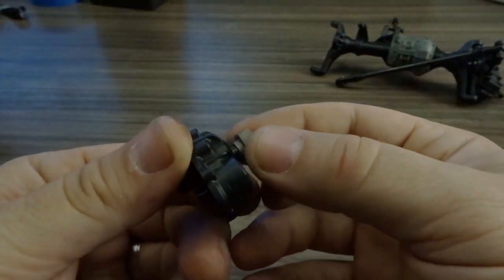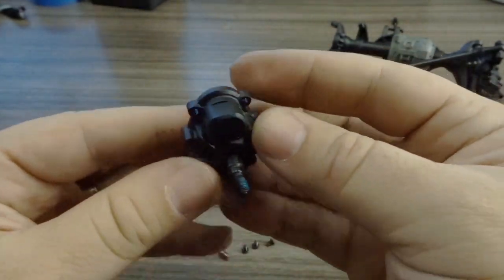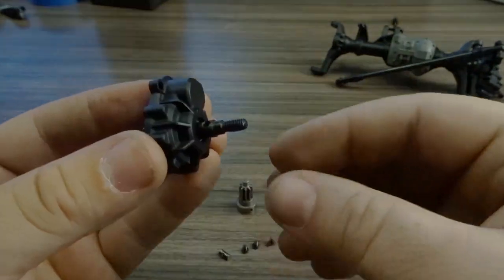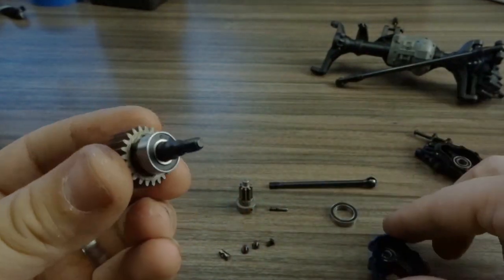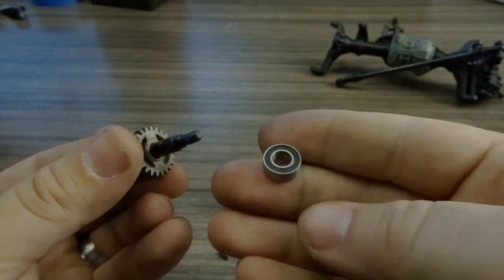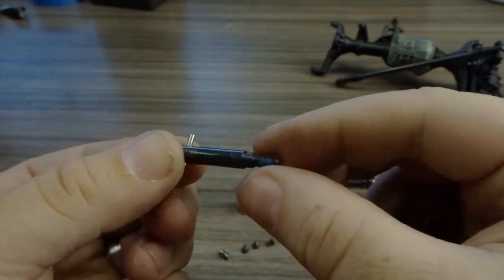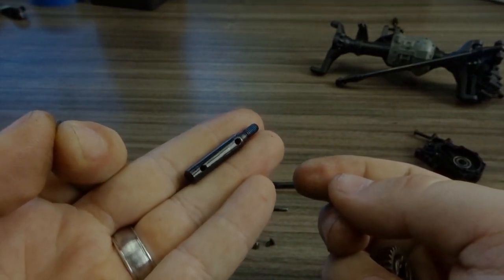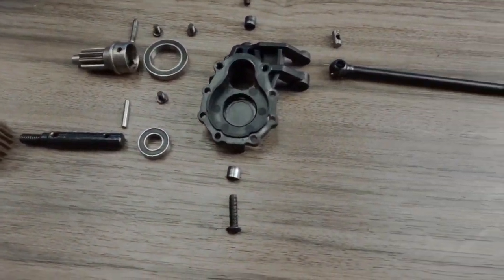The set pin retains the 12 millimeter hex. This 12 millimeter hex rides on a six millimeter stub that necks down with four millimeter standard wheel threads. This gives it a very nice beefy design because that two millimeter pin rides on a six millimeter shaft rather than a five millimeter shaft, giving you a lot of extra strength. You can remove that last outside bearing and you can see that the bottom portal gear is attached to that sub axle via a standard two millimeter pin. At that point it gives you just the sub axle, and here you can see all the components laid out that make up that portal box.